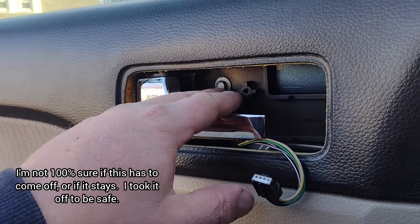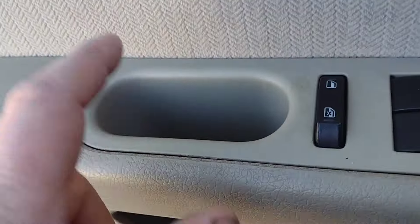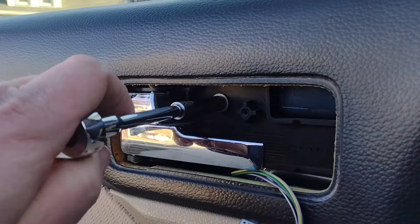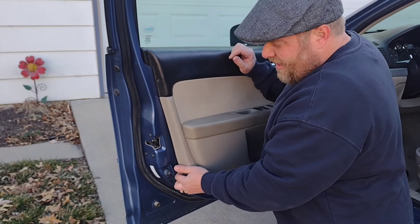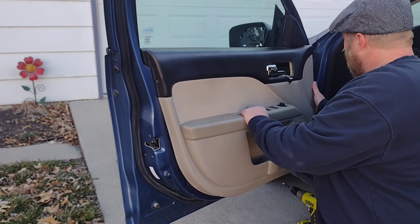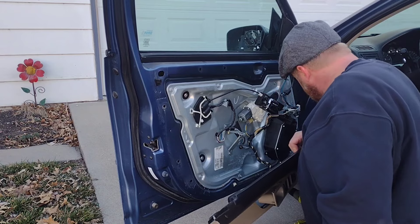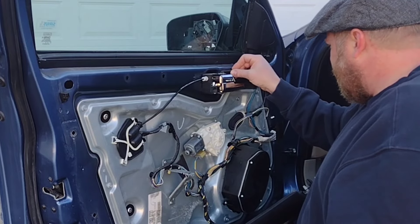The one I did forget about is back in here and I believe that's actually an 8 millimeter, so add that to your list of tools. There's one screw down here, one screw over here on the side, and then obviously the one down in here - grab an 8 millimeter and pop that out. Ideally you want to do this on a warmer day - plastics on cars do not like being pulled apart when it's cold, very high risk of breaking things. Basically just grab it wherever you can and pop these clips.